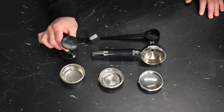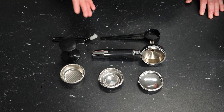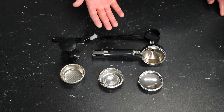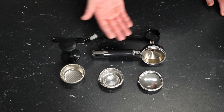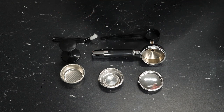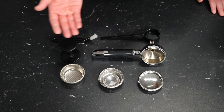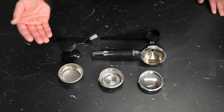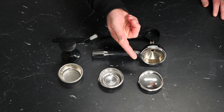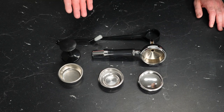This is another accessory I would recommend you replace — it's a tamper, and I'll cover some better tamping options in a bit, so you can probably say goodbye to this one. My favorite of the accessories is the chrome-plated brass dual-spout portafilter, the same one featured on the ECM Classica PID. This is 58 millimeters, so it will accept other custom 58mm baskets for upgrades, say from Barista Pro. Stock, we've got a double-shot basket, a commercial single-shot basket, and a back-flush disc.